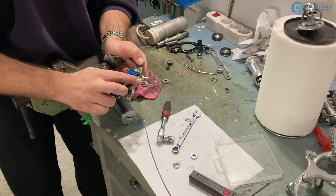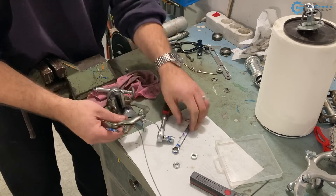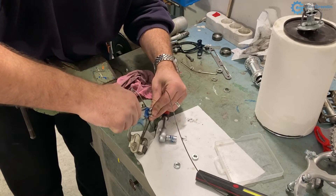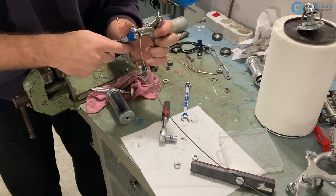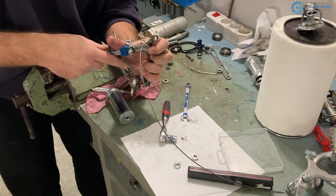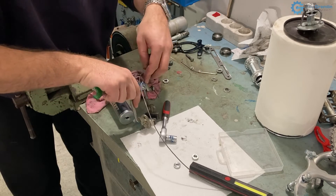I'm moving the nut just a bit and watching whether the other nut turns — if it did, I'd hold it with a second wrench. It is fiddly, especially doing it without holding the structure in a vice, but you get it done. I'm unscrewing the inner nut while the outer lock nut is held in place. Then I try to unscrew the nut a bit because it's still too tight, but it wouldn't budge, so I had to loosen the lock nut first, then unscrew the inner nut just a bit.